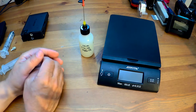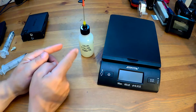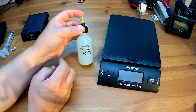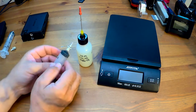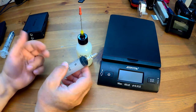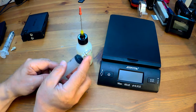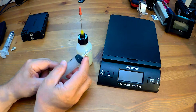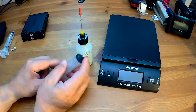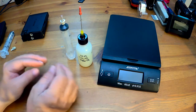It's the same thing with the Epson R2000s, 1900s, and any other printer that uses some sort of gloss-enhancing liquid. You can do exactly the same thing for Epson cards — that's how I harvest ink from them as well. I use a slightly different tip for those, which can be purchased from Inkjet Mall. Just look at their refilling tip search and you'll find several styles, each with its own purpose.